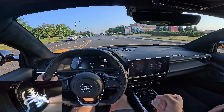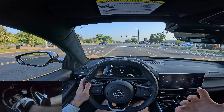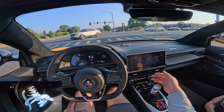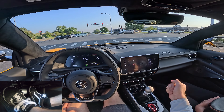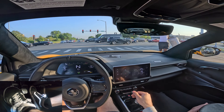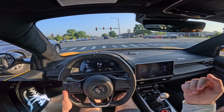Shifting gears is probably the easiest part, especially when you're driving. Right now you can see the RPM is building up — you go clutch in, bring it down to second. Now I'm in second gear, you can see the two on screen. There's not necessarily a universal time to shift, but for a more comfortable drive you'd usually want to be around 2,000 to 3,000 RPM. If you're performance driving and trying to go super fast, you can take it to redline. The gear pattern: odd gears on the top, even gears on the bottom — so to go first, second, third, fourth, fifth, sixth — that's basically how you do it. Once this light turns green, I'm going to shift through first, second, third, fourth just to show you.